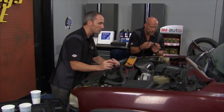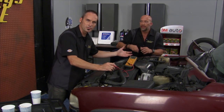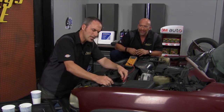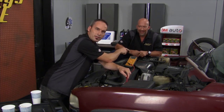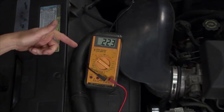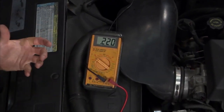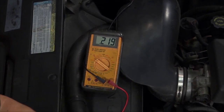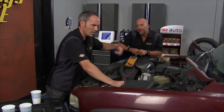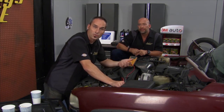So the first thing we're gonna do is check for voltage in our cooling. Did you say voltage in the cooling? Yeah, so if I drop one lead in the coolant, okay. One lead on the battery, just see if there's a circuit going on. The coolant is actually generating almost a quarter volt. Whew. Now, that might not sound like much, but that volt constantly driving is gonna accelerate the corrosion and wear